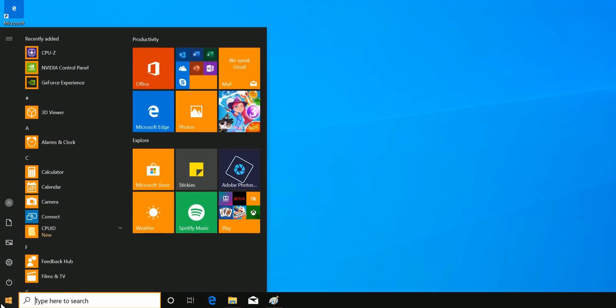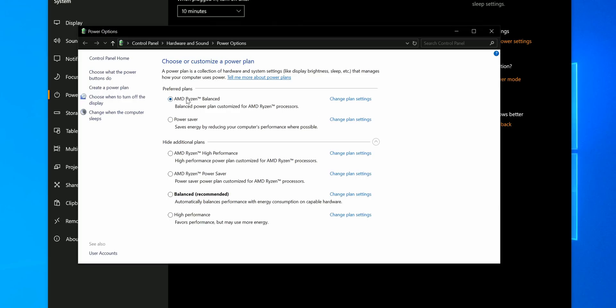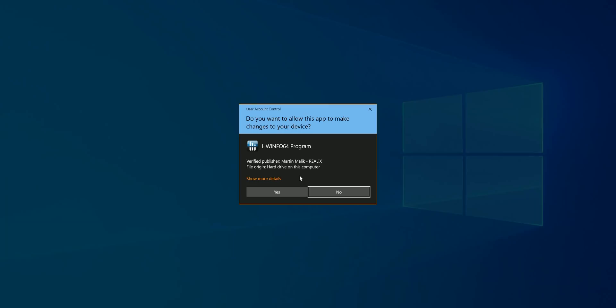Let's get into how you can test your system to ensure the CPU is running at its proper clock speed. You'll need a few programs: Cinebench R20, HWinfo, and CPU-Z — I'll leave the latest versions in the description for convenience. First, make sure Windows is running the proper power settings: type 'power settings' into the search bar, go to additional power settings, and select the AMD Ryzen High Performance power plan. This ensures no aggressive power-saving settings interfere with the processor's ability to boost. Also make sure you're running Windows May Update build 1903 and the latest chipset drivers from AMD's website.